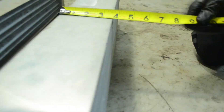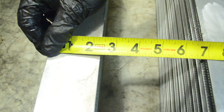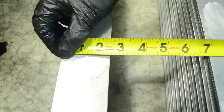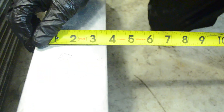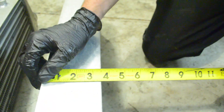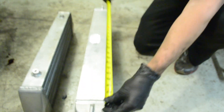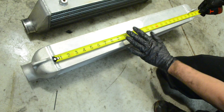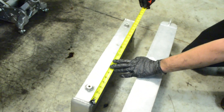You've got depth, clearly. This one is a 3.5-inch, while this one is about 2.1 inches — so you're upping it by almost an inch just in width, not to mention the amount of additional fins. And then you've got the width of the core, which is right here. Then you've got the end tanks — the end tanks don't have any of the cooling material in them. So this is a 24-inch core while this one is a 20.5-inch core.